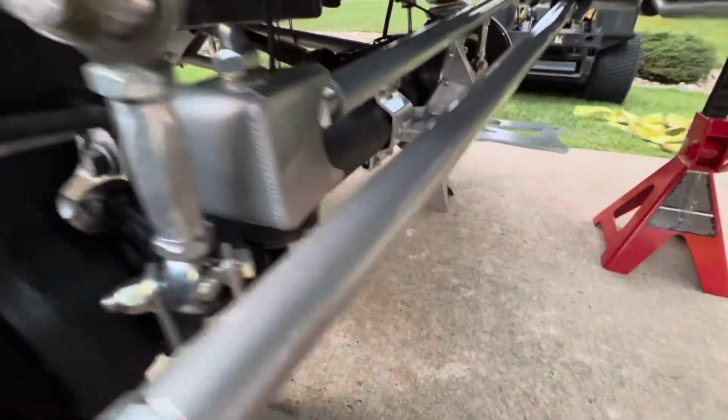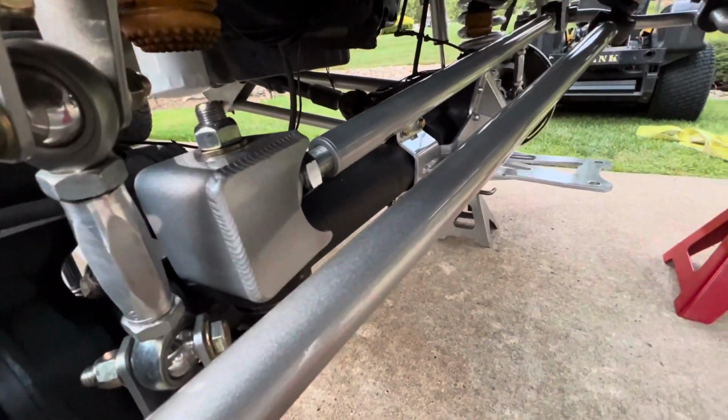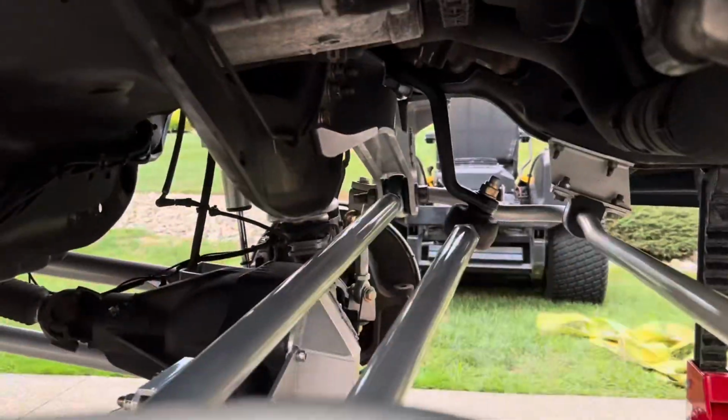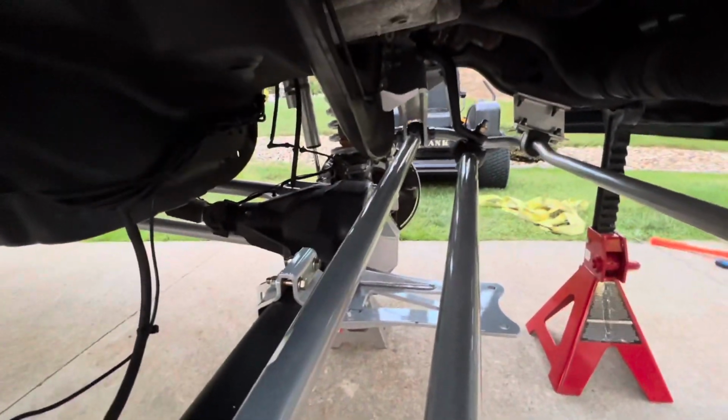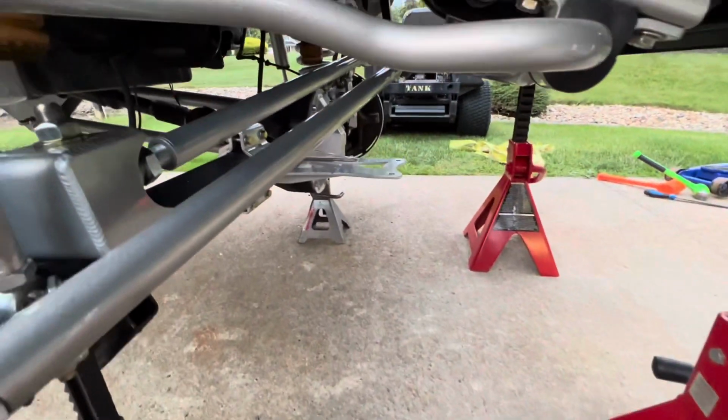All right, y'all. Track bar, this part is good and tight, and that part is 350 foot-pounds on my torque wrench. So yeah, I'm gonna tighten them jam nuts down, and I mean, it'll probably need to be adjusted maybe again, but we'll see what we're looking like here. We'll throw this tie rod bar on, keep the process going.